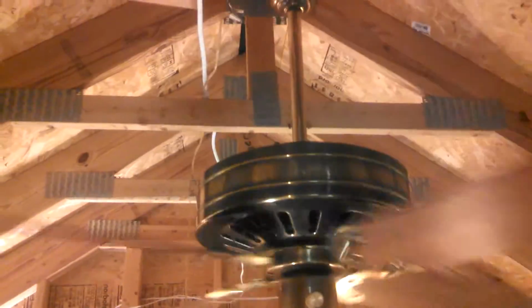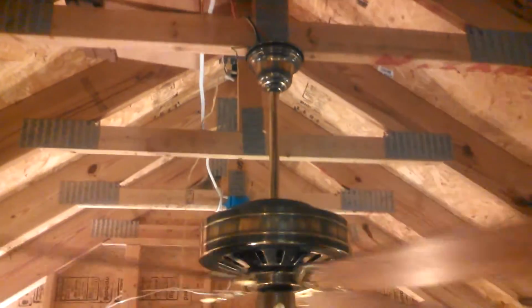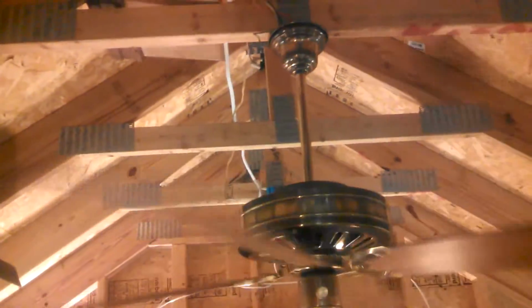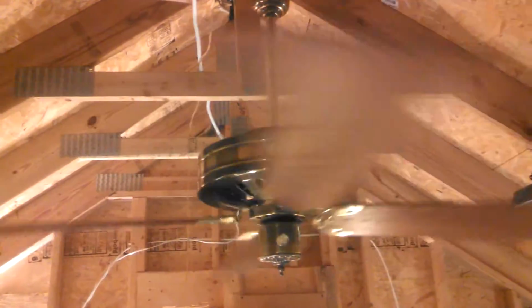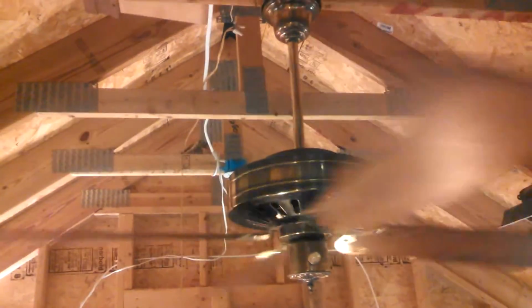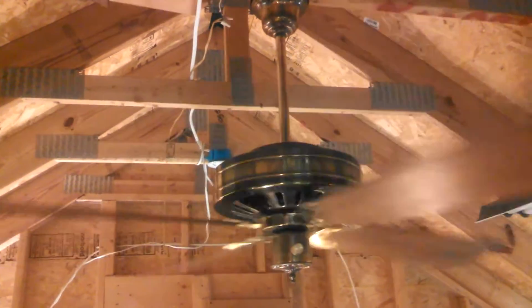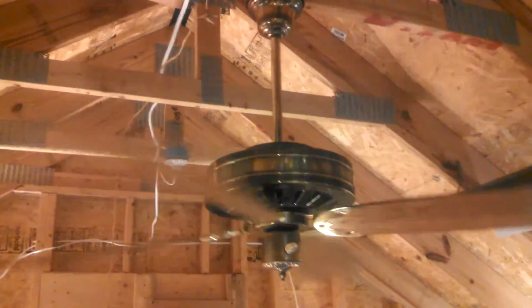It's got a smaller galvanized steel pipe inside, and then the polished brass part is just decorative. But it's 1/2 inch. It's the first time I've ever seen that with 1/2 inch. And it's definitely the first time I've seen it on a Thomas. And the down rod mounts to the motor in a way that I've only seen on Homesteads. It screws into a flange, and then the flange screws to the motor with 4 screws, and the part of the motor that the flange screws to is part of the top end bell. So it's cast into the end bell.